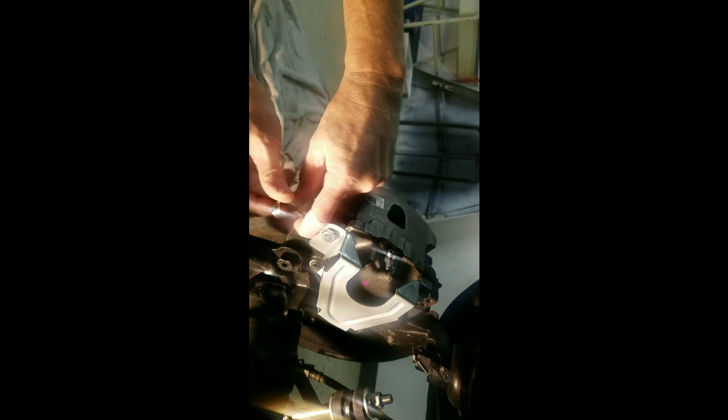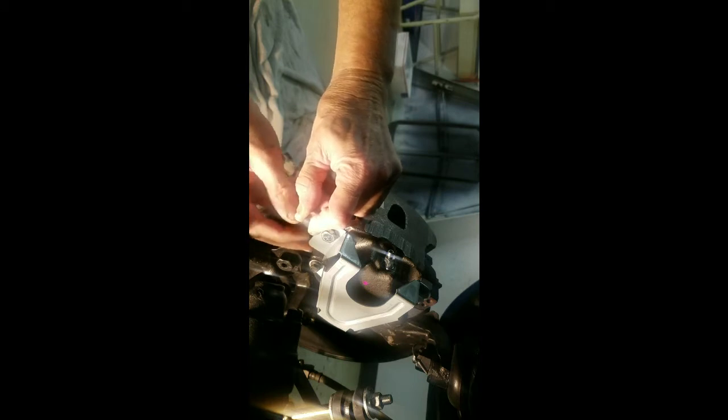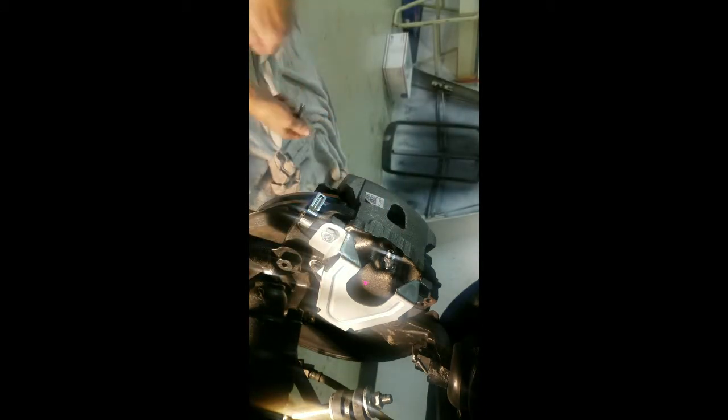Okay, you put these in, I find, sideways. You rotate them up, and they go in pretty easy. But that holds that brake shoe down. And that also is a 3/8. Well, it said it was easy to get in there. I think we got it now. Oh no, that's a 7/16. Surprise, surprise. Luckily I got one of them laying right there because I wasn't real sure which it was.